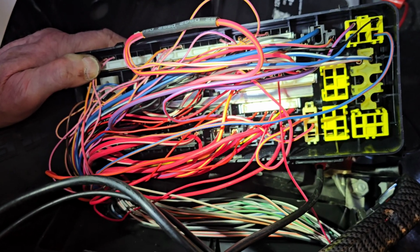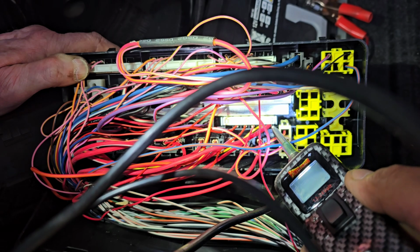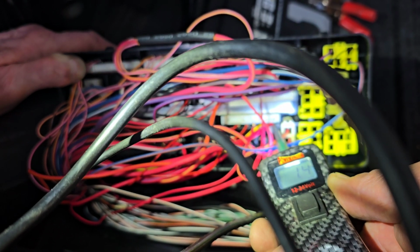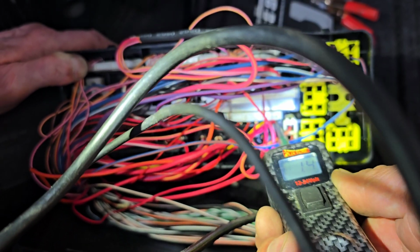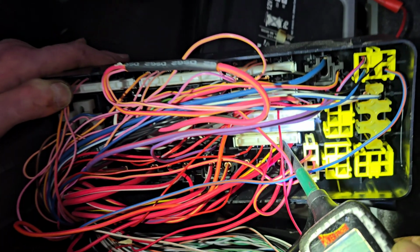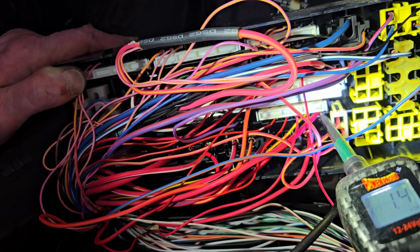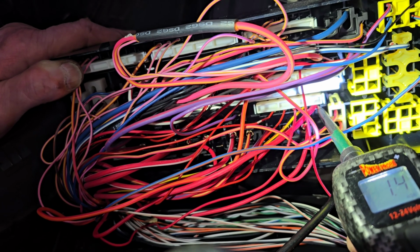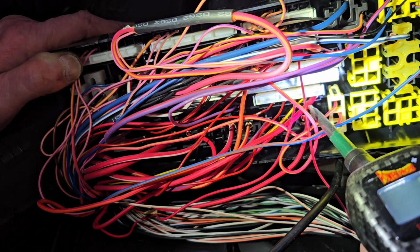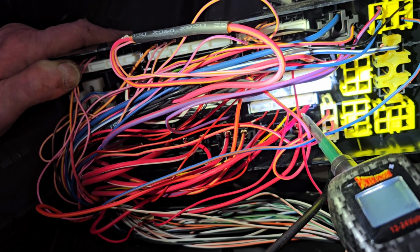Alright, so this is underneath. Now, this is the first fuse. As you can see, we got the fuse blown that's out. There's no power there. Right here is the 12 volt feed in. This is a 12 volt line. This side is out to after the fuse, which goes through, I don't know, maybe 12 gauge wire. That is power for the amplifier.